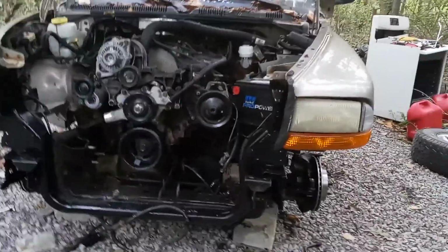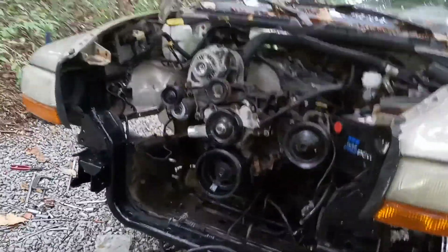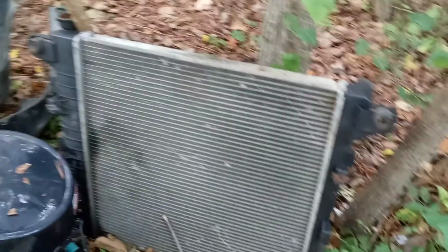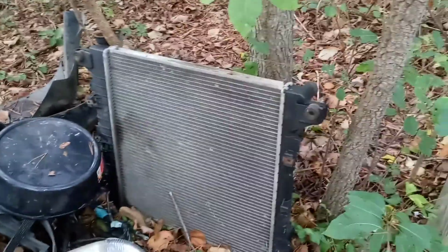And to me, it's weird how they did it because they got it tied in. It goes through the radiator and it cools it off, and then it turns around and cools it off again through that external cooler, so it cools it off twice. So I guess it keeps from getting really overheated, but this one didn't have it. But it'd be mounted on the front if it did. Yep. I'm glad it don't, because they want almost 40, 50 bucks more for that, and it ain't worth it really. You could bypass that, you don't need that.